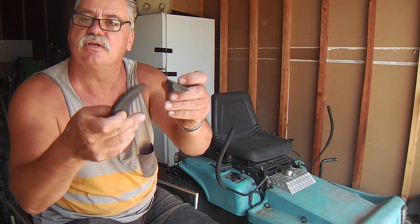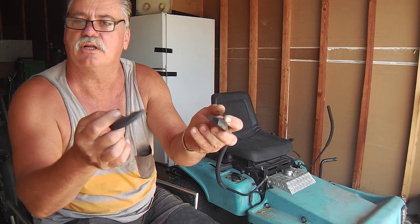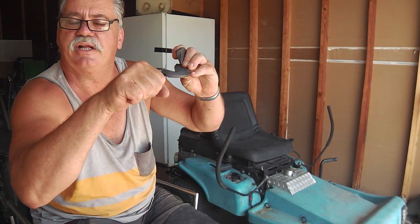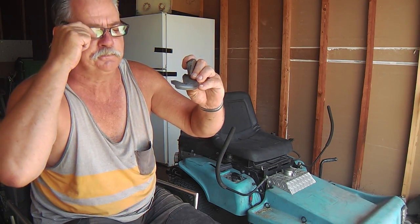and I did retrieve what had come off down below, and lo and behold, it was the cone. The cone had started to obliterate, the skirt of it had, I guess I was running it so hard on that side that it just broke it off down below. I was able to limp my way back. It just didn't have much power because it didn't have as much to grab onto. So I've got cones. I just happen to have them handy, and